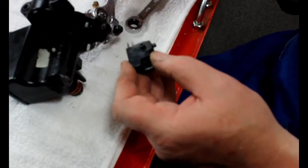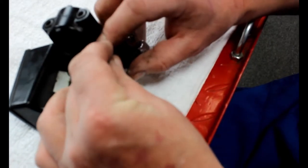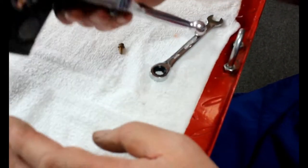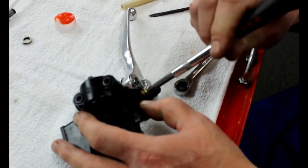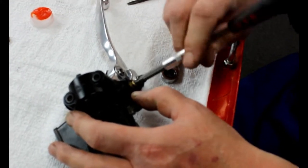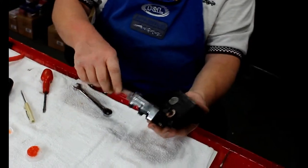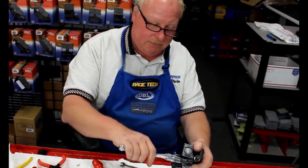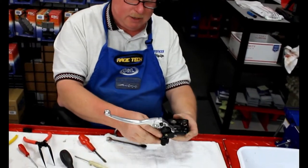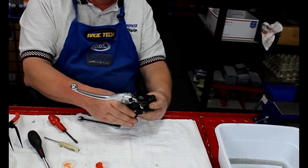There's kind of a sharp edge and a rounded edge on these sealing washers — I want the sharp edge facing towards the brake line because the sharp edge is the side that's going to seal the best. I'll put this in place so I don't lose track of it. Last thing: brake light switch. There's a little alignment nub that aligns up with this, and I've got to be careful because I've already put the lever on — I don't want to break the nub off. Push it in until it clicks in — I felt it drop in the notch, looking good. In goes the screw. This is another screw that doesn't need to be ridiculously tight — I have seen folks actually break these switches by putting monster torque on the screw. Snug it down good, folks. And there you have it — a decent master cylinder serviced with Brake Crafters top quality components, everything looking good and moving real smooth.